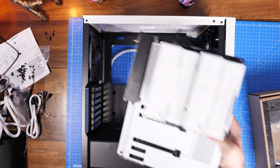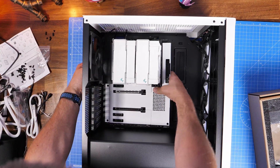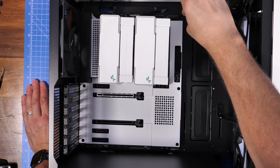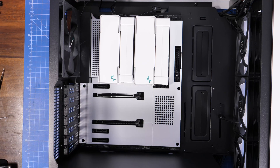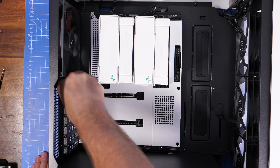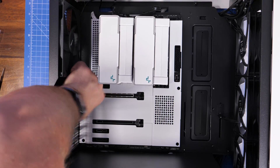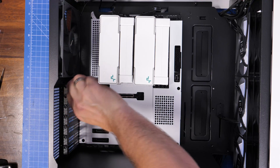The biggest problem I had with this motherboard is installation. This is an ATX motherboard and the case supports ATX and other sizes. The standard standoffs are fine, but the motherboard screws are really difficult to get in — particularly all points other than the top ones, where there's no protective housing. The case screws have a wide top and you basically have to force them through the hole in the protective plating to reach the screw holes. It's pretty terrifying.